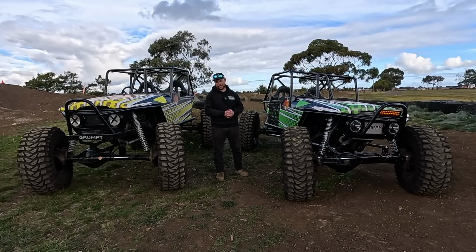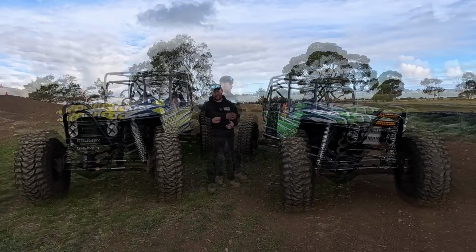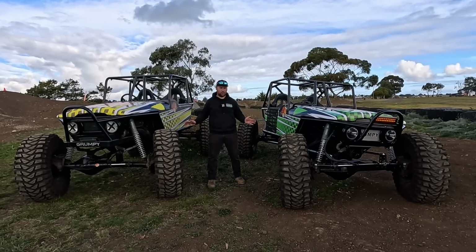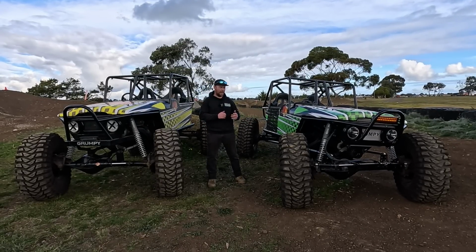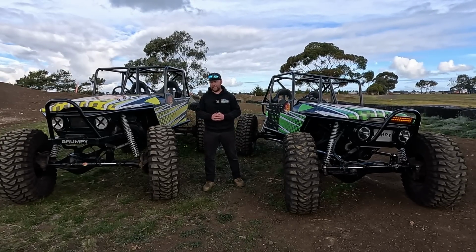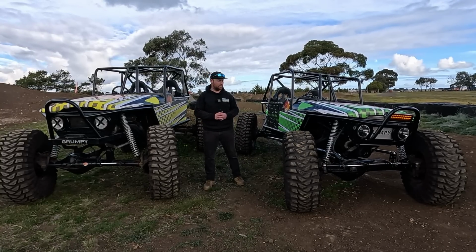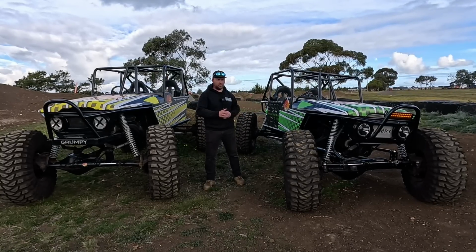They both run on gas, so they can run on big angles. Fuel starvation is never really an issue. They both run Turbo 400 autos with a nice high stall kit and Atlas transfer case. Now, these initially were built like 15 odd years ago, and they've been a very solid setup for some time now. But the upgrades to the new one will be very welcomed.